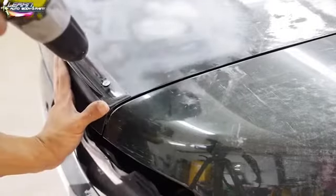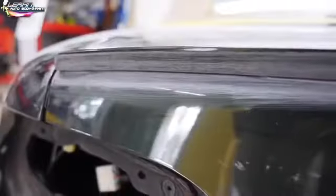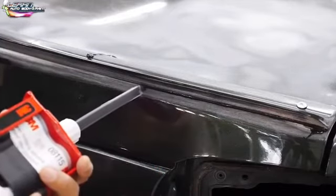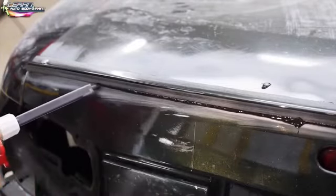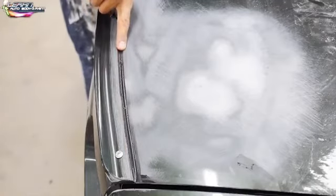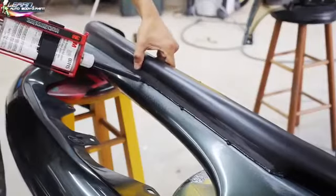Then I'm gonna take out those sheet metal screws and fill it — you could either do it with epoxy or filler, it's all up to you. This is the epoxy process right after we laid our lip spoiler, got it on there, put two screws in it, then put the epoxy — this was all covered in the previous video. Now once this is done, we're going to use our body filler. I had a vote with some of our members on whether to do a finger mold on the trunk lip or a complete mold, and we ended up doing a complete mold, which I'll show you in the next videos.